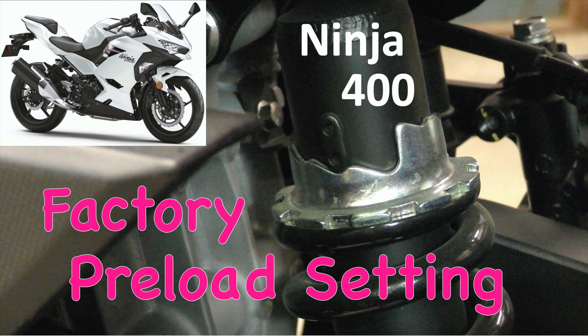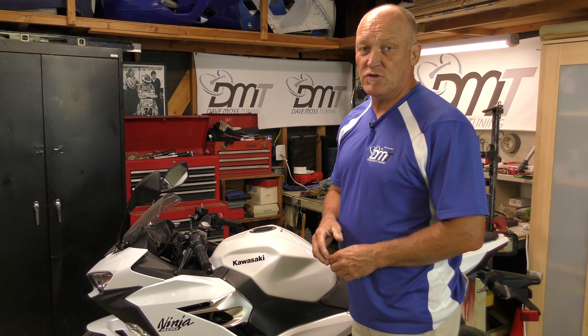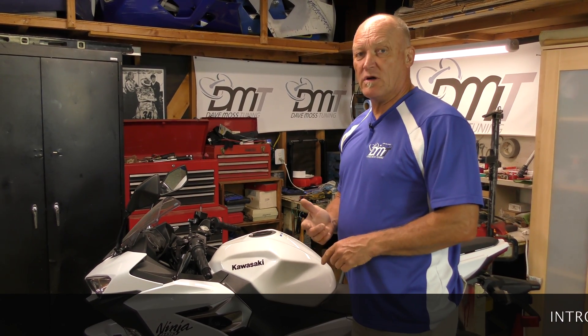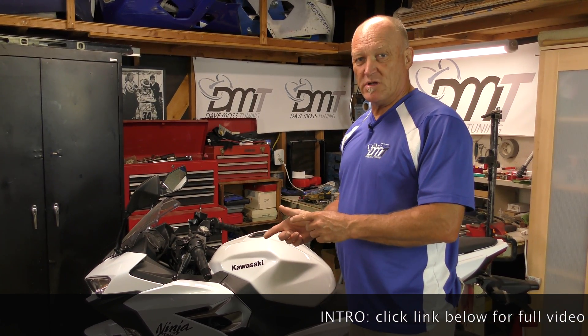Non-adjustable budget forks, damping rod — as per the category, that's not unusual whatsoever. One of the things that's really important with a damping rod is what oil viscosity we are given when the forks are produced and put on the bike.